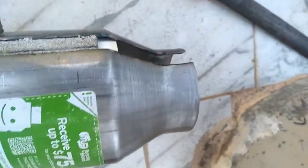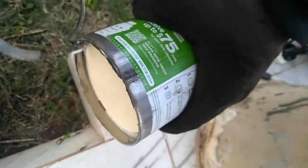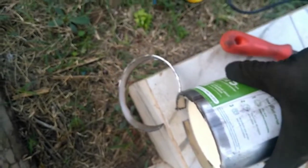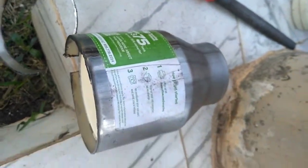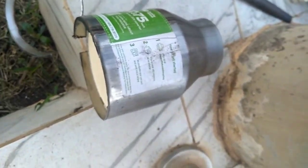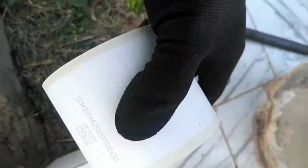We're taking off some more material so the casing should slide out easily. Using clean hands so that you don't clog the pores of the catalyst, pull out the substrate material from the casing. Here's what we have — everything intact, no damage at all.